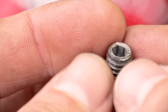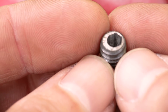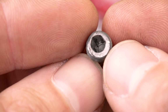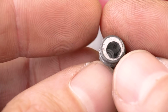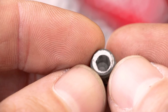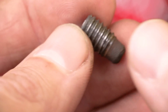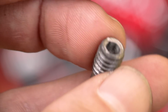And let's look at the end of our broken bolt. As you can see, we've got nice, prominent markings there inside of that broken bolt where that R.B.R.T extractor bit, and it bit all the way through to the bottom of our drilling. We got nice, prominent marks where it sunk its teeth in to pull this bolt right out of there, even though I drilled it crooked, as you can see. But again, I was trying to work with the camera between me and the work, which is not always the most ideal situation. So, really cool. Again, we didn't damage our threads. I'm just gonna chase them anyway, just to be sure, and we can go ahead and install a new bolt in there and be hunky-dory.